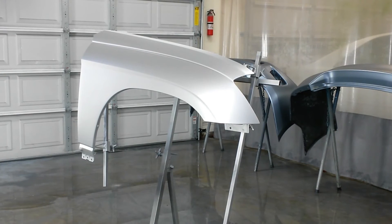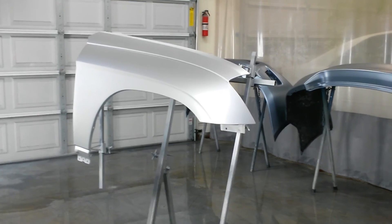I'm ready to tack it off for the clear. I only want one coat on all the jam areas, so I'm going to do that right before the second coat. That way I'll get a solid closed coat on the second coat and then I'll get one coat on the jam — that way I don't have any dry spots around the edges.